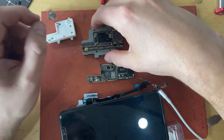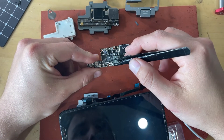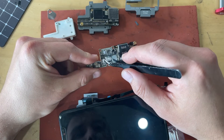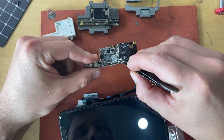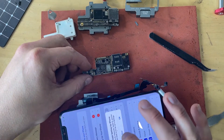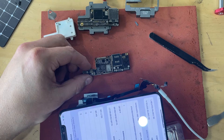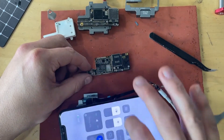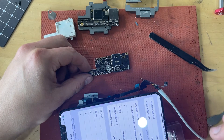On the XS Max this is the old board, and what I did was pull off the baseband chip right here — that's smaller than a dime. There's a tiny little EEPROM here that holds some data for it; I had to transfer that over, and then this Wi-Fi chip here was transferred over too. Before the repair, when you went into Settings > About, you were missing modem firmware — it would show 4.02.02 as gone and would constantly search for service.